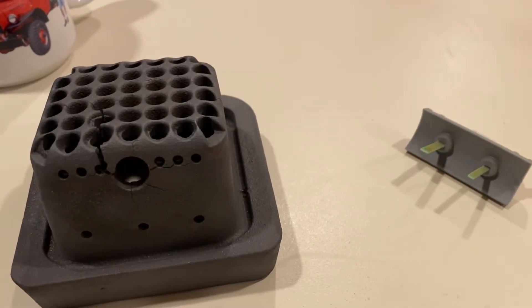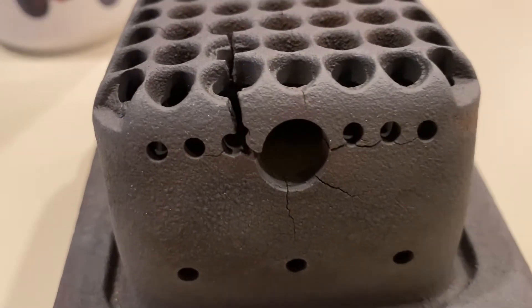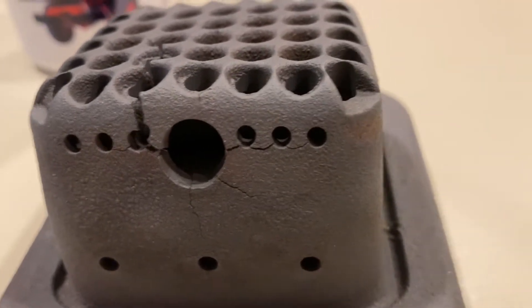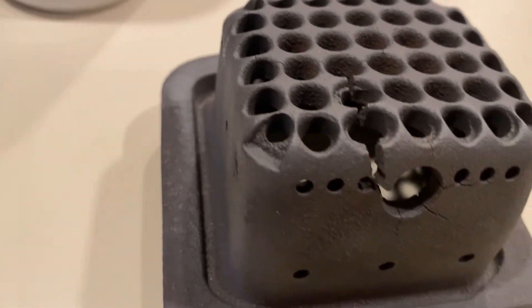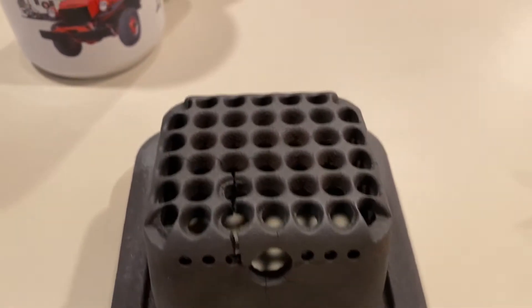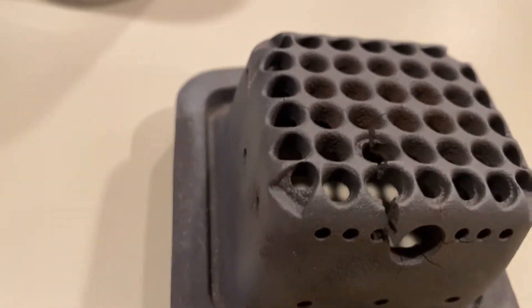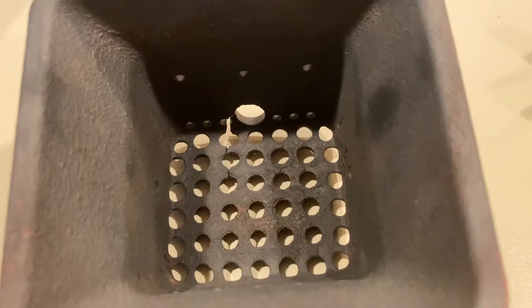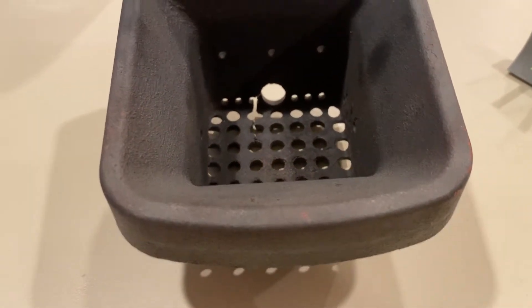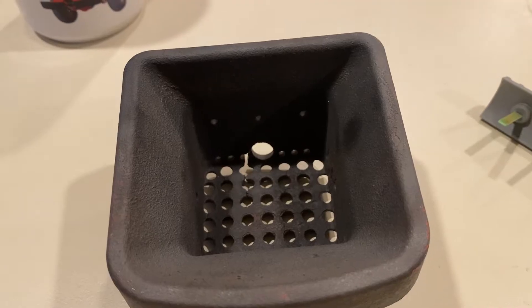Of the four issues that I've had with my pellet stove, I've replaced the burn pot at 3,900 hours. It actually started cracking at about 2,500 hours and I just let the cracks continue to grow until I replaced it. This burn pot has been sandblasted to clean it up so it's a little easier to see. You can see it's got quite a few cracks in it. The inside actually looks pretty good — a little pitted from use, but otherwise fairly good. It's about $100 to buy one of these new.